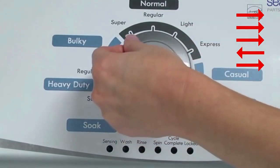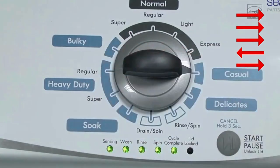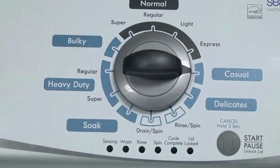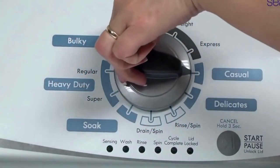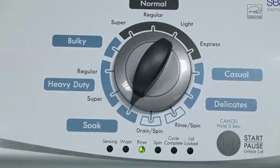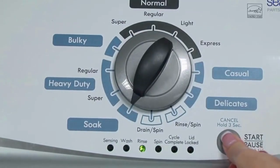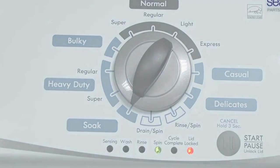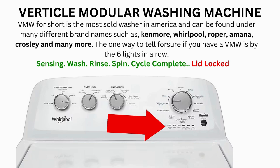Quickly, within about 6 seconds, turn the control dial 3 clicks clockwise, 1 click back, and 1 click more clockwise. All the green status lights blink when you successfully activate the diagnostic mode. If the status lights don't blink, try again, this time turning the knob faster or slower. In the diagnostic mode with all lights flashing, select the calibration cycle by turning the control dial 4 clicks clockwise. When you're on the correct setting, the rinse light turns on — then simply press start. The calibration cycle runs for 2-3 minutes as it checks all the cycles and functions on your machine. When it ends, if all goes well, the lid unlocks and the washer shuts off. Try your washer to see if that solved your issues; if not, continue to the error code video.